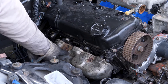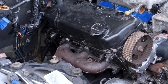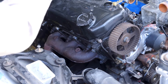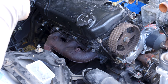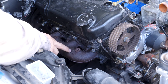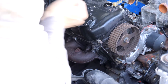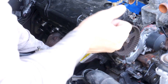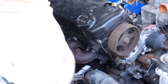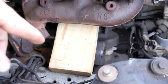I got the bolts of the heat shield off so I'm just going to take that off right now. The right exhaust manifold should be much easier than the left because I couldn't get the EGR pipe off or the heat shield, so I had to work around that. But on this side I can actually get a breaker bar and a ratchet on — I did the hard side first. Before I loosen the nuts I've got a block of wood spanning this gap so it doesn't fall down into the engine compartment.